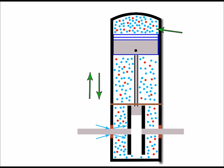And of course, all of the fuel-air mixture is destined to go to the top of the piston for combustion. And if that mixture is not correct, then combustion isn't going to take place correctly. And in this case, it's simply all down to these seals leaking. And it's something that's often overlooked. I have found this particular issue a little more common in the past. I've had this quite a few times. But ultimately, because of the extra air that's coming in where it shouldn't, weakening the fuel-air mixture, it will lead to bog down.